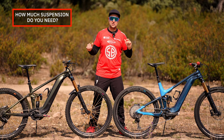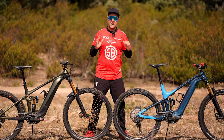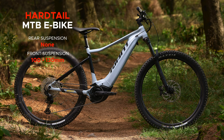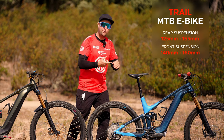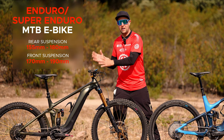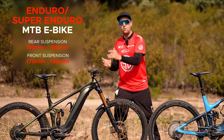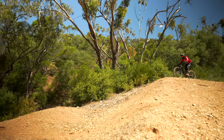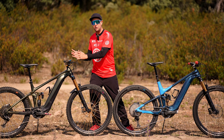In this video, we're going to look at how much suspension you actually need, because every ride is different. There are loads of electric mountain bikes on the market, and I hate to see people on the wrong one. We've got a hardtail with no rear suspension and 100 to 130mm up front; a trail bike with front and rear suspension from 125mm up to around 155mm; and an enduro or super enduro with 155 to 190mm in the rear. You might think bigger is better, but having too much suspension can actually be a con.